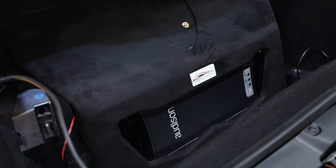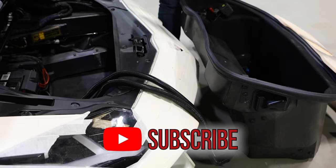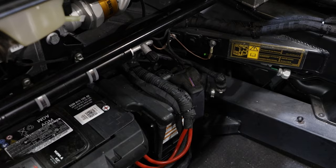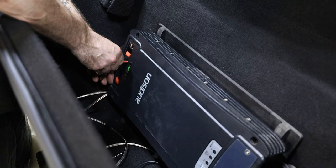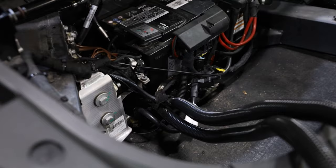In terms of coming into the vehicle, you can see the conduit tubing here — just to make everything neat and tidy. All cable runs going into this tub area, and everything in terms of our wiring has run through alongside manufacturer wiring. Speaker cables and everything go through alongside factory grommet positions, running through the actual vehicle through grommets. You can see some of the cable ties we've added — we've run alongside completely.